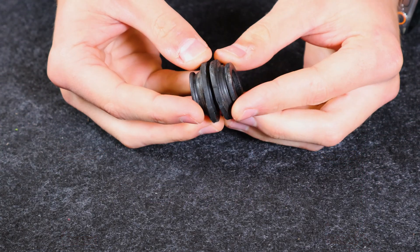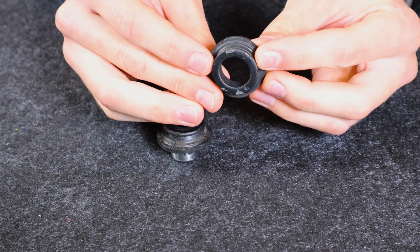For the carrier bushing install, it's much easier overall, but the one tricky part is getting the factory parts apart. They're pressed together, so you'll need tools — pliers, vice grips, maybe a flathead — to pop them apart. On older cars with more corrosion it's a little trickier, but some penetrating oil will help. Other than that it's pretty easy, and you don't need to remove a shield, so it's easier than the lockdown install. You can do it underneath the car on jack stands.